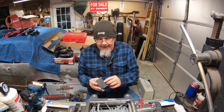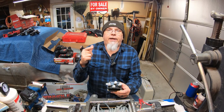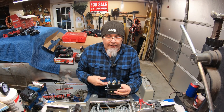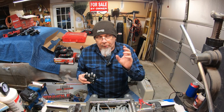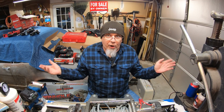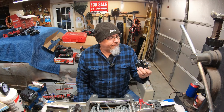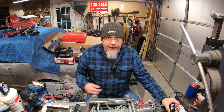This one's a little bit different from the last one I wired up. But if you want to know how to wire one of these up, check out the video that'll be linked at the end of this video — it explains how to wire up one of these winch solenoids. This procedure is for a series wound winch motor. Now the permanent magnet type winch motors only have two wires — basically all you're doing is it's wired one way for positive and negative, runs one direction, then you flip the switch and it reverses the terminals and makes the motor run the other way. The permanent magnet motors are a lot more simple than the series wound motors. If you want to know how to wire this up, check out the video linked here. Thanks for watching and we'll see you next time.